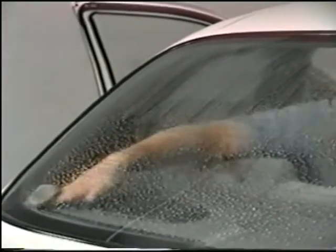Before installation, you will need to prep the window. Start by spraying the window with soap and water solution. Using your steel wool or scrub pad, gently scrub the entire surface of the window. By doing this, you're making sure that no debris or contaminants will come in contact with the film. Never use a razor blade or sandpaper for this. They will remove or scratch the defroster lines and therefore destroy defroster efficiency.